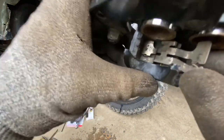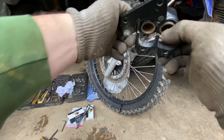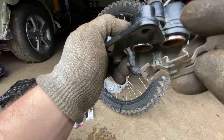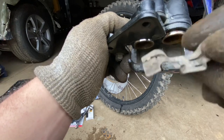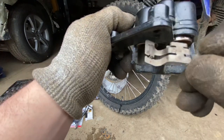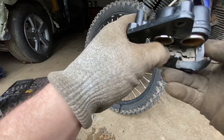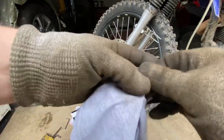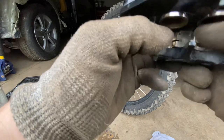Now I can show you this little spring a bit better — we'll pull it out. The outward-facing part of the caliper goes right on the bike like that; this is the back side. The spring has two flanges that grab onto a ridge inside. When putting it back, the piece that grabs on goes towards the back. This part doesn't require any lubrication — just wipe off grit and grime, then pop it back in.